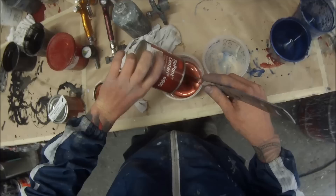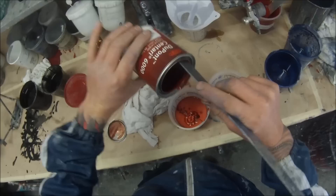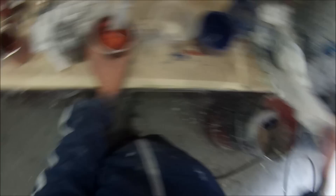Now I'm taking you through a separate base coat colour. We did the clear coat before - that was our Standox clear - and now we'll do our Dupont base coat. It's the same thinning ratio on the side of the can; it's on the side of every single paint can in automotive. You will have a reading on there with a DIN or a Ford 4 cup.